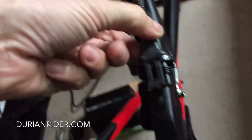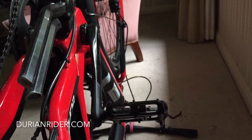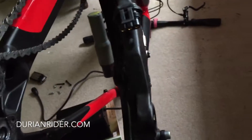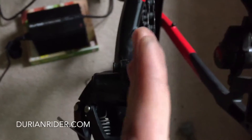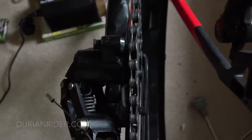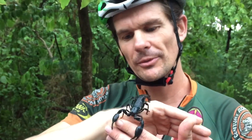With the wheel out, plug the little power connector back in there — obviously with the bike turned off. Put it back in with the quick release — sorry, through axle. Another tip: you can put it in the smallest gear, as the smallest gear makes the derailleur sit a bit straighter and makes it easier to put in. If you like this video, give it a thumbs up.